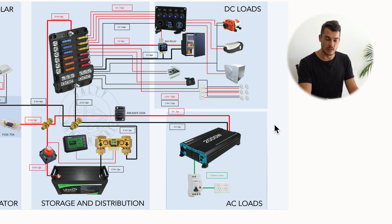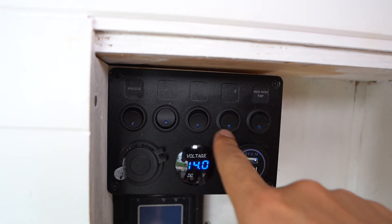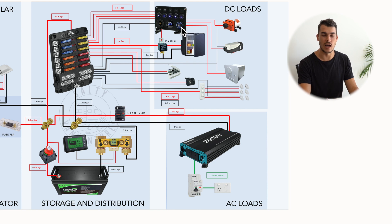The way I've set my system up may be a little different to a lot of other people. For most of our units, I wanted to switch them separately — so if a unit doesn't have its own switch, I wanted to be able to turn it off. This is where the switch panel comes in. These things are great: they've got five switches, a cigarette lighter 12 volt port, USB charging ports, and a voltmeter. They come with inline fuses, but because I wanted all my fuses in one location I decided to bypass those fuses, which meant running a couple more wires to the switch panel — but much neater and easier to troubleshoot.